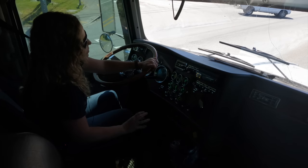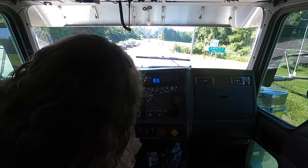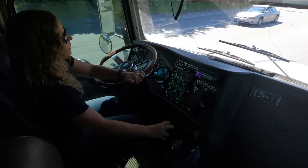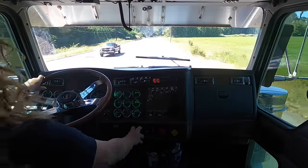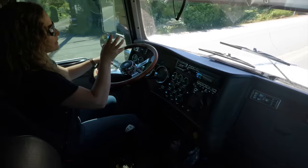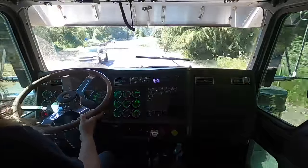Being that I'm on flat ground I'm going to start off in one high, so I move my thumb selector. The truck's not in gear, my foot's on the brake. And if you don't already know this — in trucks you don't push the clutch to the floor unless you're at a complete stop. The reason for that is the clutch brake. Because it's not a synchronized transmission, when you push your foot all the way to the floor there are little teeth that grab, and if you're moving it'll rip the clutch brake right out of the truck.